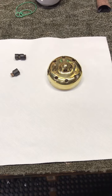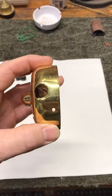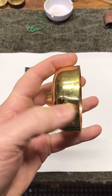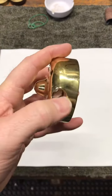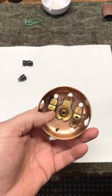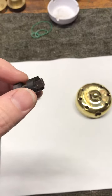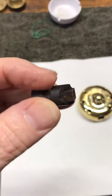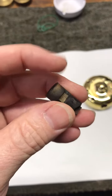I've got a 1910 Westinghouse all-brass fan motor. This is just the end bell off the rear end of the motor. This is where the brush is — normally you see the brush sleeve protruding out just a little bit, and the brush caps out on each end. This is where the brush sits right against the commutator. These things are notorious for breaking the insulators around this brush sleeve — they get brittle with age, crack, and get broken up.